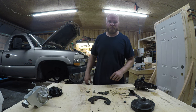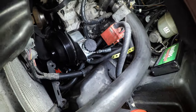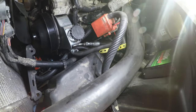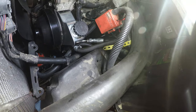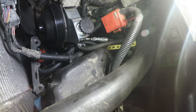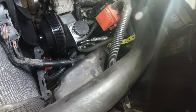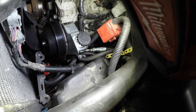Now it's time to put it on the truck. We've got the power steering pump on the truck, and the difference I mentioned previously — where the return line from the Hydroboost is on the side — it's a pretty significant difference from the factory as far as how that line goes on. I would really recommend putting the Hydroboost return line onto the power steering pump before you put the pump in the truck. Having to push down on that line with the pump in the truck was actually bending the hard line going into the reservoir, and it was pretty scary. We were worried that we might break it if we had to push any harder.